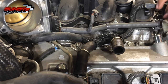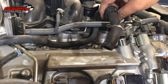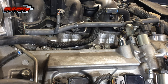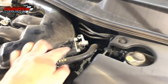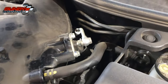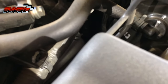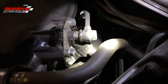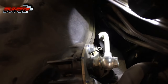Got that one free. Over on the driver's side of the motor there's a fuel line right here that needs to come off to get the plenum free. Down below I need a flashlight — I think there's a 12-millimeter bolt down there. Right underneath the banjo bolt for the fuel line there's also an electrical connector to pop off, and there's a hose down there that looks like it's part of the PCV valve system.